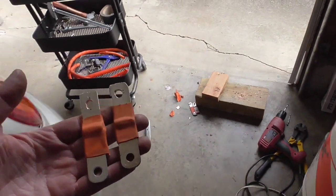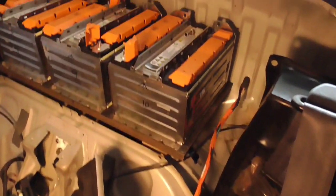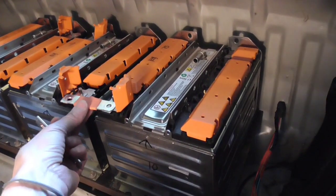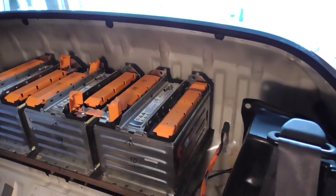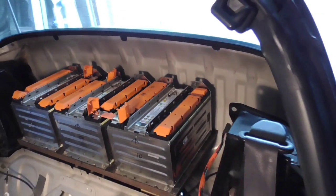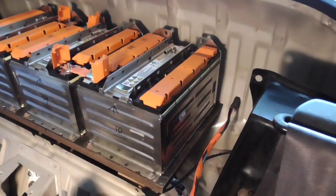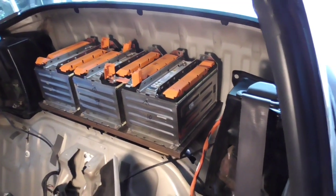So we've custom fabricated some bars going across here. So there's existing stock and our batteries are in place. So all we really have to do is put these in, such as so. I was very careful to be touching it at the rubber insulator part. We'll go ahead and put the other one in. And these guys are ready to go. We just have to make the wire connections to the rest of the pack and then connect our main cables to the front of the car.